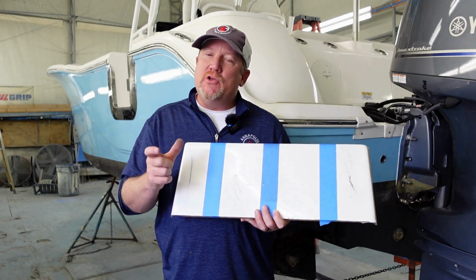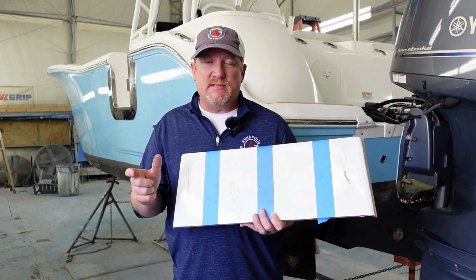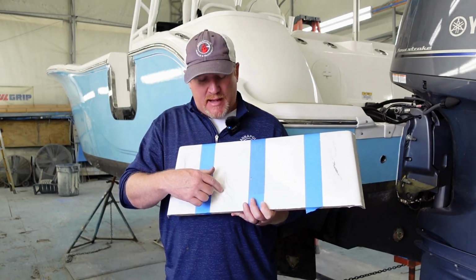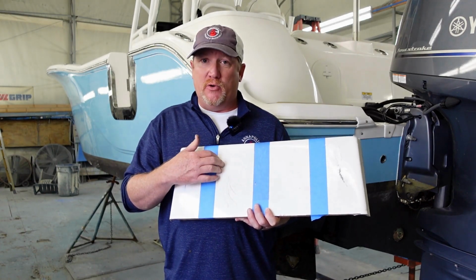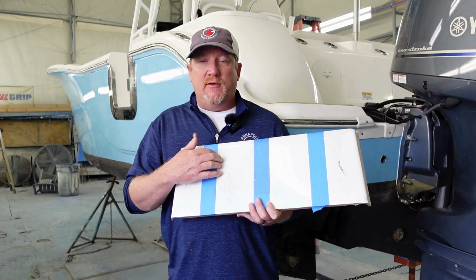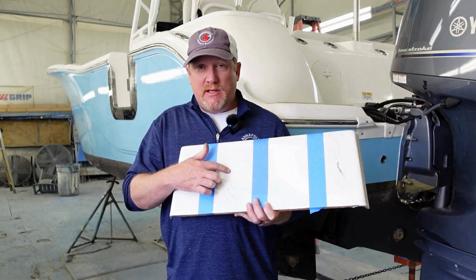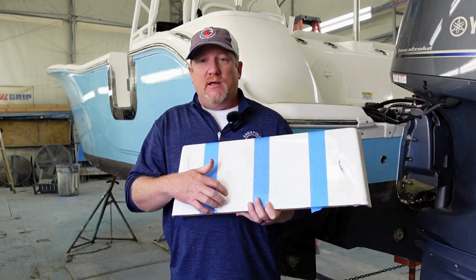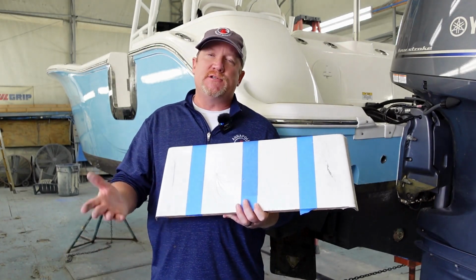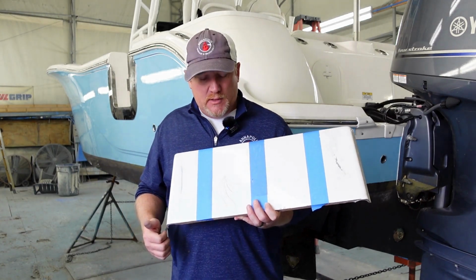the spider crack, you're gonna have a higher degree of possibility of it being a structural damage into the actual fiberglass of your boat. So it's very important that we investigate this to determine if the fiberglass is broken beneath these cracks or not. If it is broken, we go about the same process as we always do with fixing the glass first, then doing the re-gel coat.